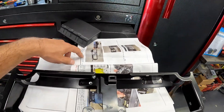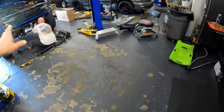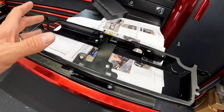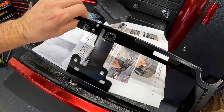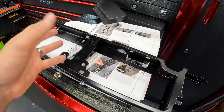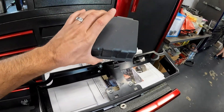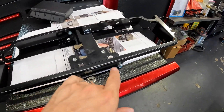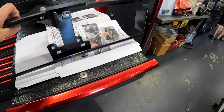We're going to deviate from the instructions that Whipple sent us because these are for the standard Bronco — with the Raptor there are a few little differences, especially on the front bumper. Another thing specific to our particular trim package: Whipple sent a bracket to mount the front-mounted radar for lane keeping and cruise control. Well, this is the box that came off the front of it and it's empty — we didn't get that option. So the way this bracket's made, we can just unscrew this piece here and get even more airflow into the intercooler.